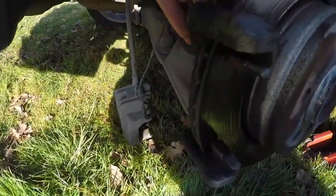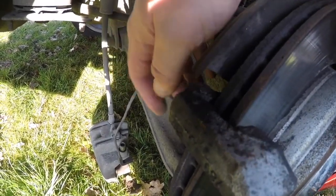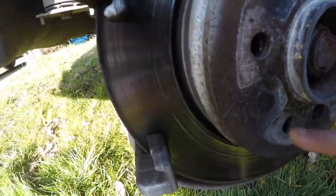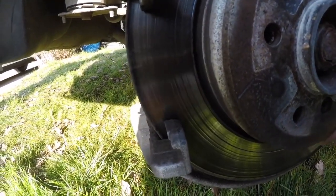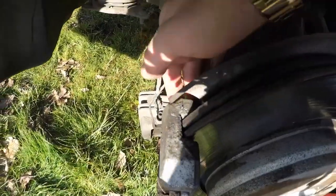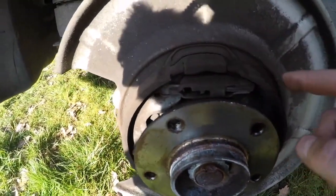The caliper's carrier is right here — two bolts on the back. I initially thought they were 17mm but the carrier bolts are actually 18mm, so note that for future reference. Take those two bolts off and the carrier will come off. Then take the allen key bolt out which is on the brake disc — its position depends on where the wheel stopped — and after that the disc will just slide straight out, giving you access to the brake shoes.